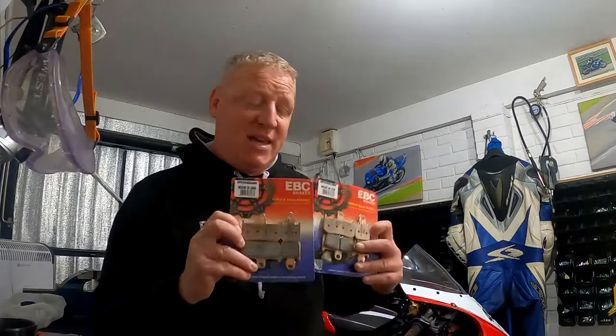So what I've done is I've bought some. I went to Yamaha and got the backing plates and also the corresponding pins in case there was any wear on the pins, as they were leaving the pads a lot of room to move around. Four pins, four backing plates — £61. Blimey. Also, the pads in there have plenty of life but they're Brembos — I think they're red stuff race pads. I'm sure we weren't getting anywhere near temperature and maybe they were grabbing. So I went to DR Bikes, a lovely bunch of guys, and got some EBC GP Fax race pads for £120 a set. Six-piston caliper on the 2007-2008 R1.